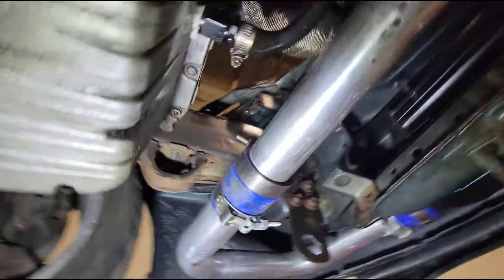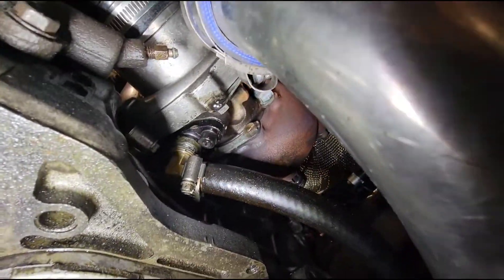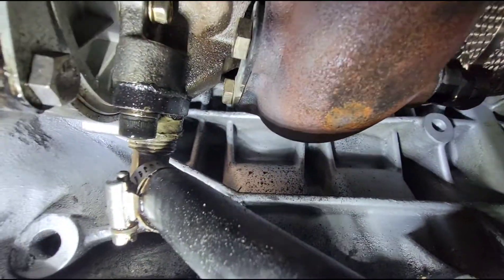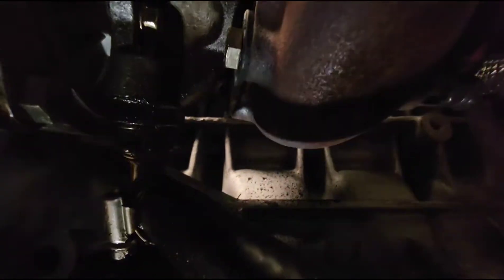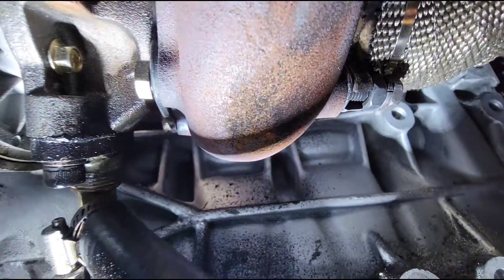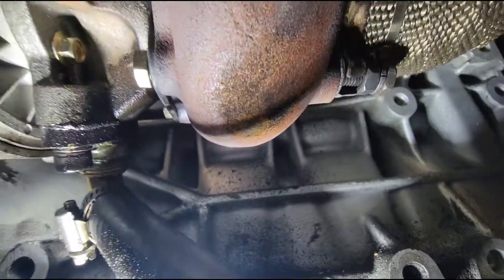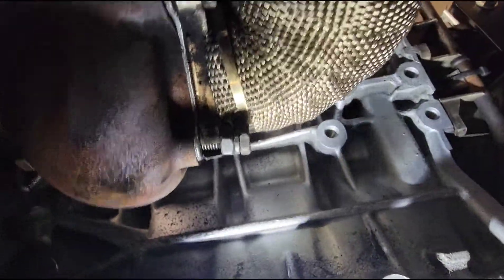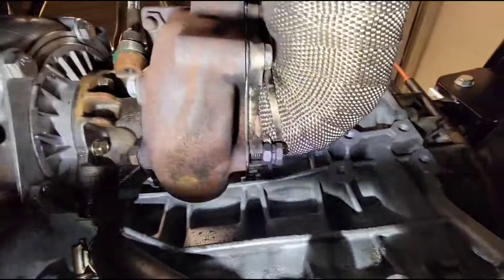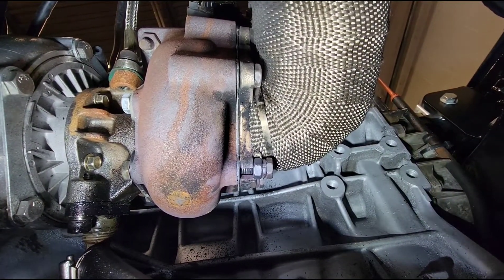You can see the oil return line is leaking. There's also a 90-degree fitting coming off the turbo. You never want to use a 90-degree fitting on a return line if you can at all avoid it. You can also see carbon soot on the block — possibly coming from the turbo — and you can definitely see the exhaust leak right there on the downpipe.